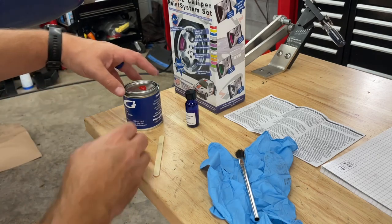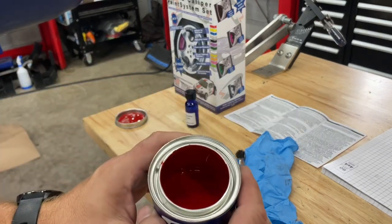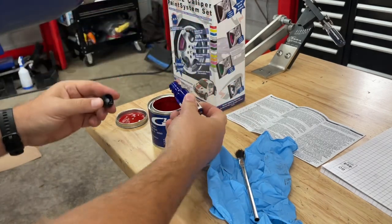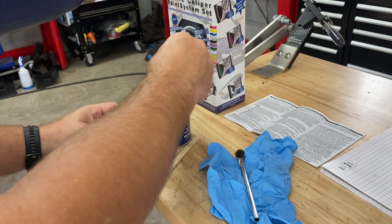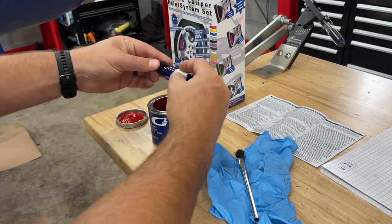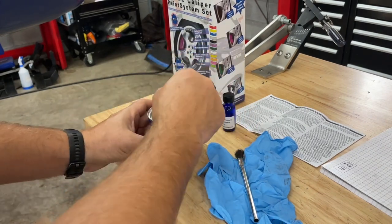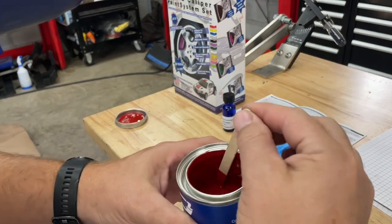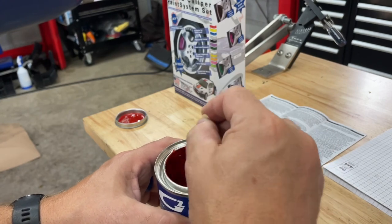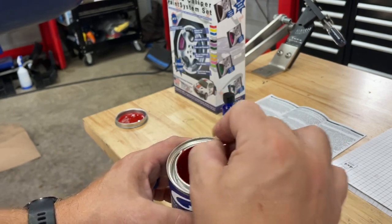The G2 paint here — we just opened up. They say it's enough for three coats, so we'll see — it's only a half a can. We mix in the hardener, the entire bottle. The plan is to stir it. In this particular setup, you're supposed to stir it for a minute or two and then let it sit for five minutes, then stir again and you can start painting. So we wait for the reaction time and after five minutes, we can start painting.